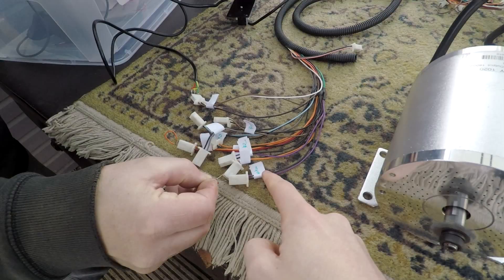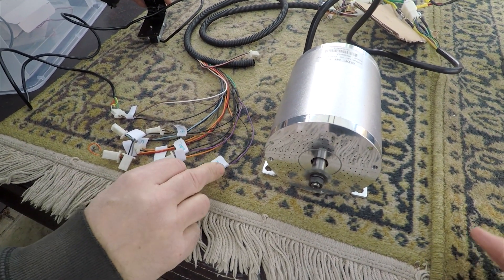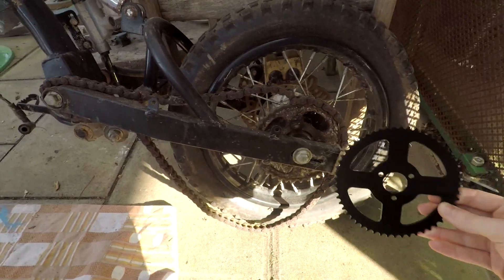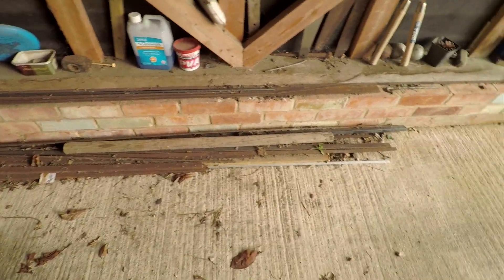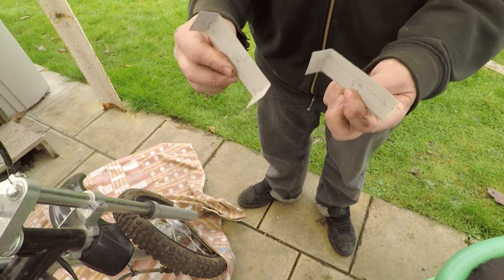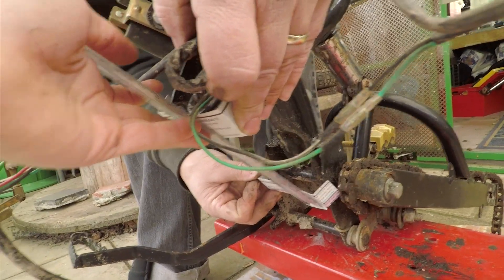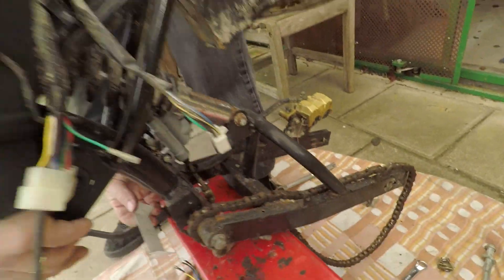It's such a small sprocket. This is the brake line, so when that's connected it will automatically stop, so you can't be braking and accelerating at the same time — makes a lot of sense. Here's the sprocket that is going to go on the back of the pit bike, so we need to work out a way of getting this to work with a freewheel. We've got a metal stash for brackets and stuff we're going to make. These are the two cardboard-aided design bits, so that'll be out of metal, bolted there and then another one down there, with bars going like that which will bolt the motor on. Then we need a bit of a longer chain to connect down to the back — but that's the rough plan.